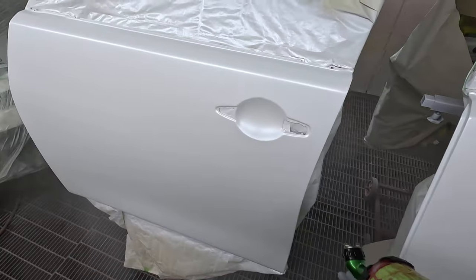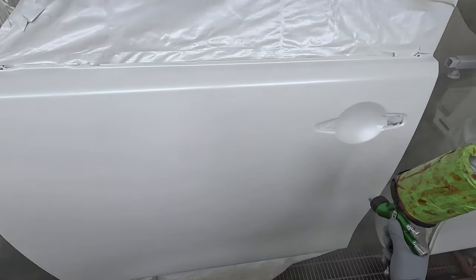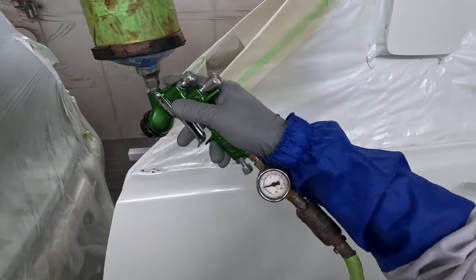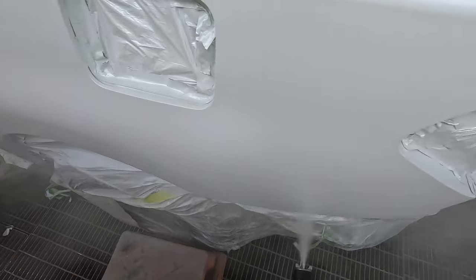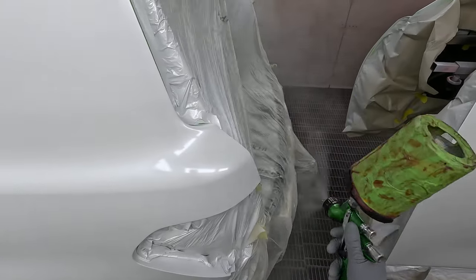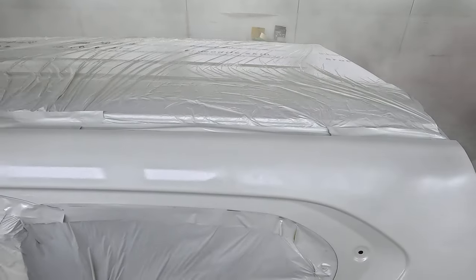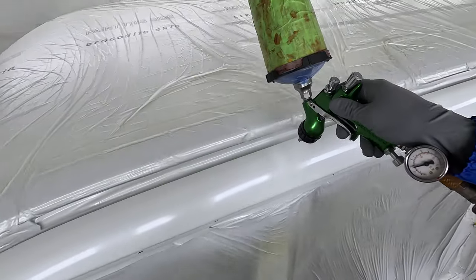If there's a good spot or two where you can see through to the base coat on your first coat of clear, don't worry about it. The most important thing is to get the first coat down nice and skinny. I put a 1.2mm on my gun — the Pro-Lite T110 air cap. I hold the gun nice and close and I'm moving fast. I've nailed this product. It is the best PPG clear by a country mile — not just a little bit, a lot better.